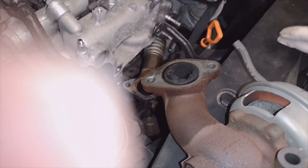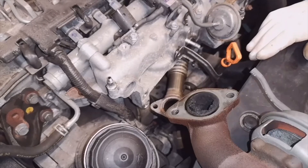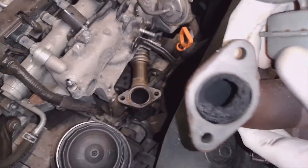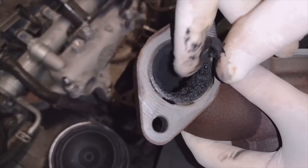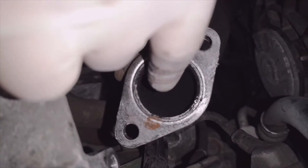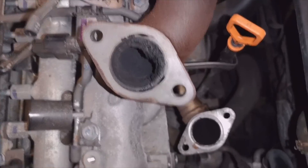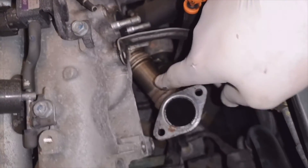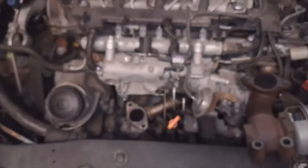Take your other gasket off — that's now going to be useless, don't reuse it. I'll put a link in the description for new gaskets. There you can see the EGR and this is after 86,000 miles — as you can see straight away, it's just like a blocked artery. That all needs a good clean. The same goes for in here as well — you want to clean in here since that's where the gases go. It's not as bad in there, it's mainly this that was choking it up.